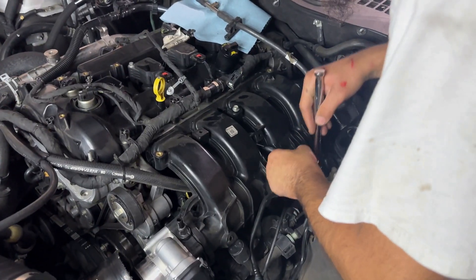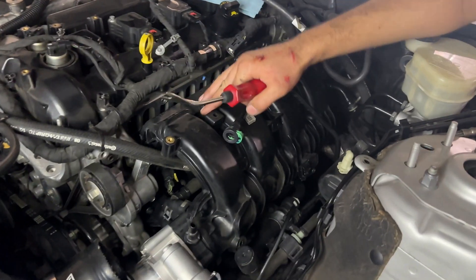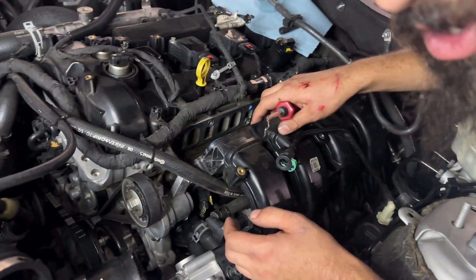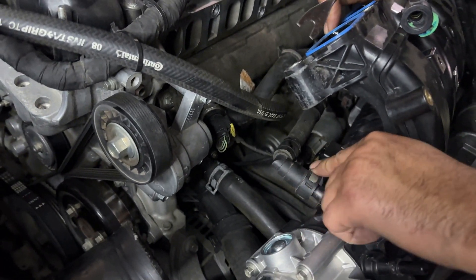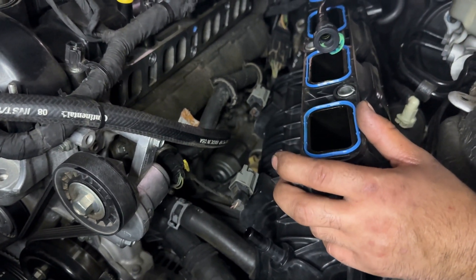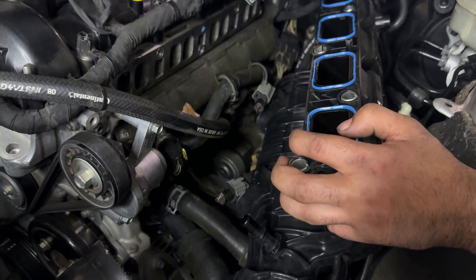We're going to start taking this out. There's one bolt down here right behind the pulley — very hard to see — and there's one over here, one in the back, and the last one is right here. Now your intake runners have two cords attached to the back side that go to your knock sensors. You're going to need a fork. Pull back but not a lot, because you'll rip those and you'll cry — trust me, I've seen it. Pull those tabs inward because they go forward. If you have an oil catch can, keep that in mind.